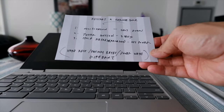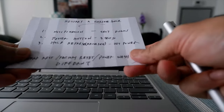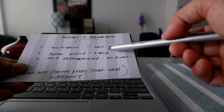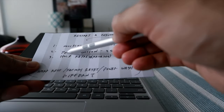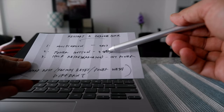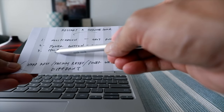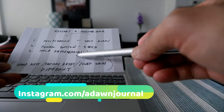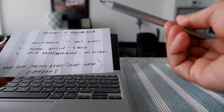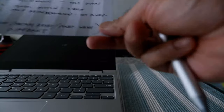I have an index card with all the instructions written up and we'll go over it. Basically there are three ways. The first is to go to the notification section and shut down the computer, which works as a restart. The second option is to hold the power button for three seconds. The third option is to hold the refresh button — located above number 3 and 4 on the keyboard — and then hit the power button together.